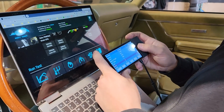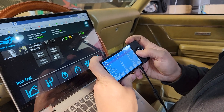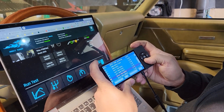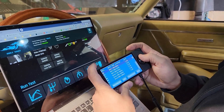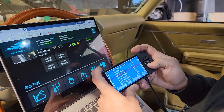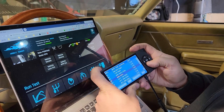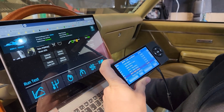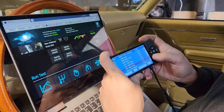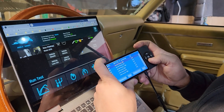I'm going to look through and make sure there are no fault codes - basically looking for red flags, making sure the tune is not out of whack. 13.6 AFR, that's fine - we don't have boost on this so these don't matter. Wide open throttle in the 12.6, 12.5, even 12.7 or 12.8 can be okay. I don't like to push it any leaner than that, especially on a street car, definitely not on a bigger motor. On these hot-running Pontiacs I might even have the high RPM running a little rich just for that extra cooling effect on the exhaust valves.